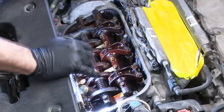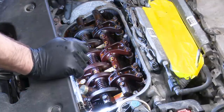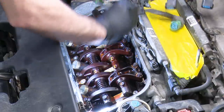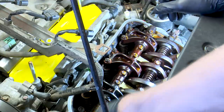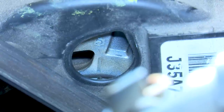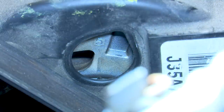The thing I haven't mentioned yet is how do we know where to set the camshaft for which cylinder we're working on — because we have to have our cams set in the right spot to adjust the valves properly. Luckily on Hondas, according to our service information, there is a cover on the front cover that we can pull off. There's a sight window that lines up, and there will be a number right on there. As we spin the engine around, our goal is to line up this little notch with the line and the corresponding cylinder we want to adjust first.